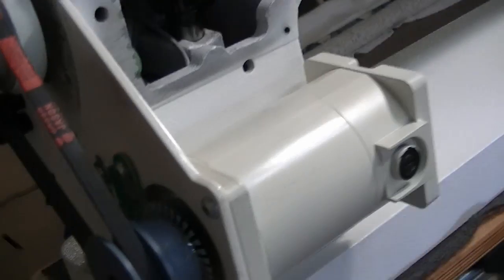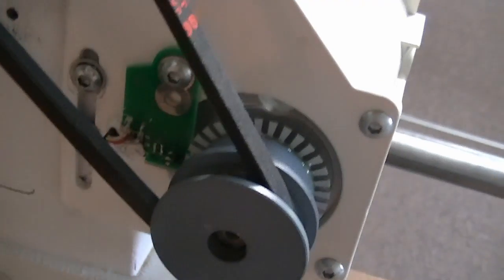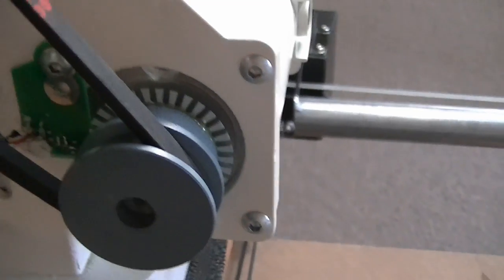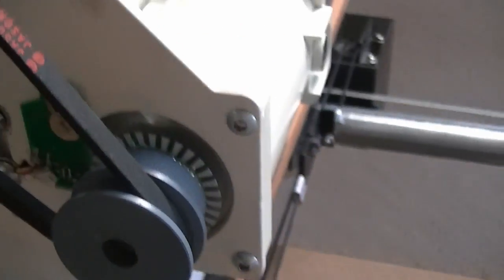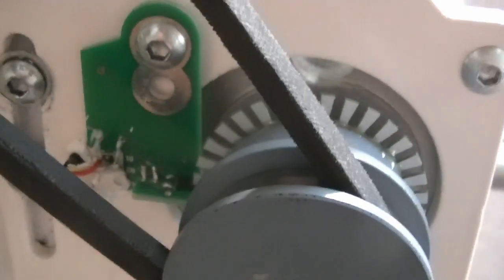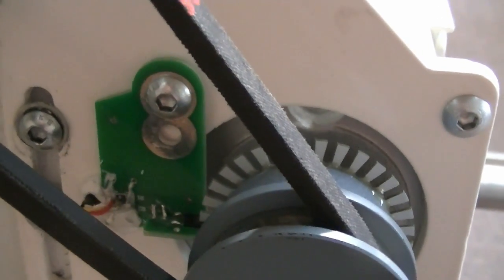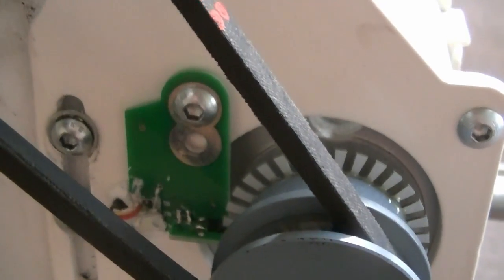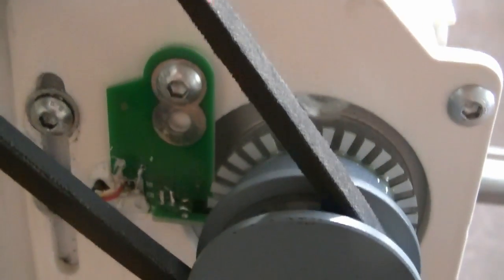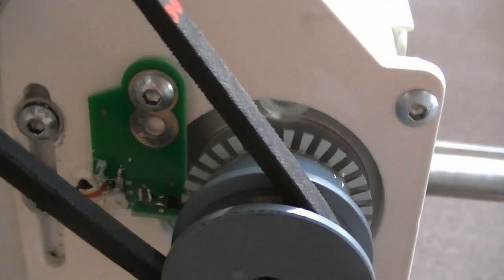Anyways, what it turned out to be was this sensor on the motor, and what that does, it tells it how fast to go. So without knowing how fast to go, it cannot do needle up, needle down, we found out. This one control, which is the same exact sensor, looks like it might be harder to change. I changed it myself because, again, we got it home, no machine running, just drove 400 miles. So I took matters in my own hands again, and she gave me a bunch of sensors and different things anyway. So I just started changing everything.